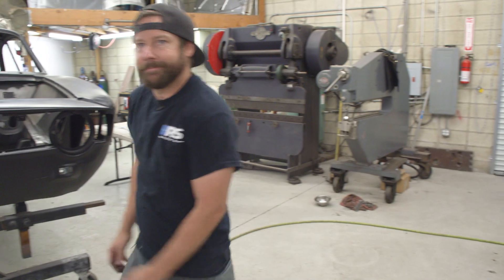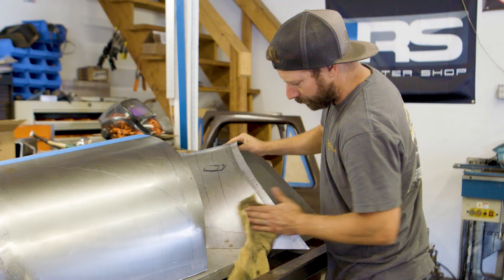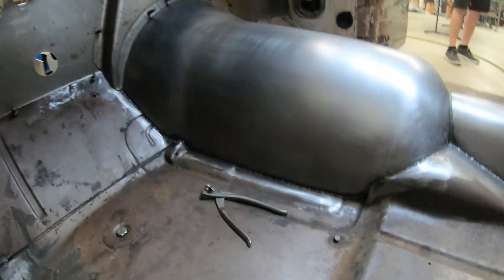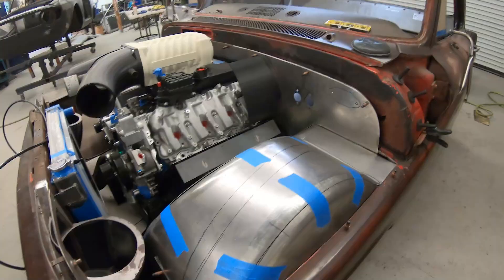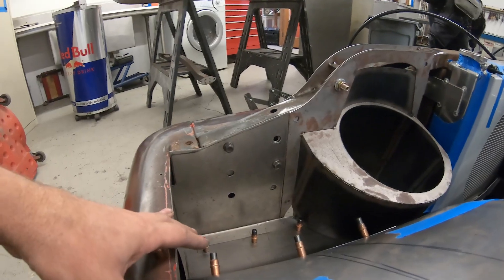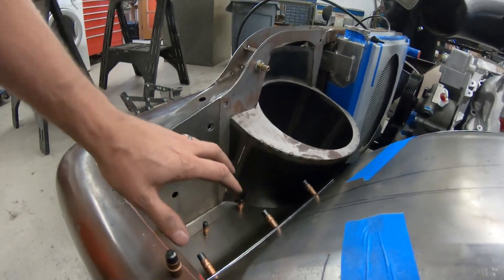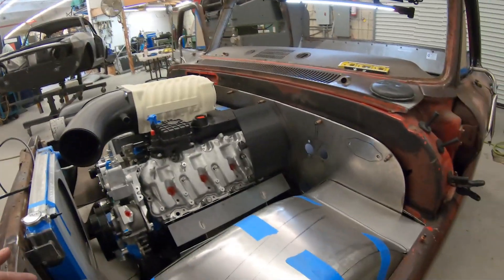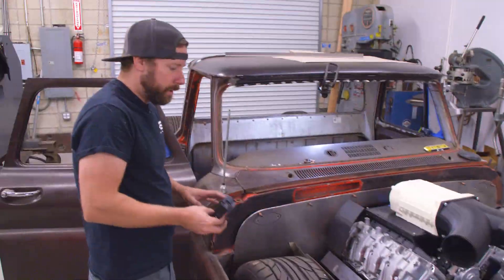The easiest thing to do is just to do it. Last time you guys were here, we were working on the transmission tunnel and the driveline tunnel. This is the tunnel — it's actually two pieces welded together, fully welded here. We did the driveline tunnel straight back, decided not to put any beads in it, just like the look of it smooth. We wanted to focus more on the engine bays. We got all this fully welded in and that is all set up final. Right now on the engine bay, we've got the driver's side tub laid out and the pieces are made, with clearance for the hood using a factory-style spring setup instead of shocks. We'll design this all together with the firewall, then stamp everything, put the pieces together, fully weld them, metal finish them, and get them bolted in.